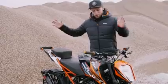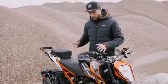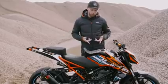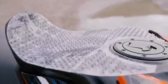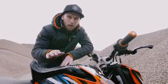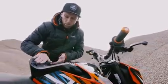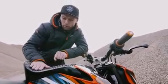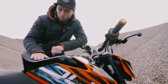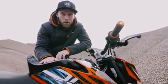So, for this 2018 stunt bike we needed to develop a lot of new parts and update the old ones since this bike has a new frame. Let's start at my favorite part — the stunt tank. Finally, after I got my first Duke back in 2011, this new model has a metal tank, which makes it much easier to reshape. We cut away the top and added a lip, giving a nice shape with a lot of stability when sitting on it. We also added Blackbird rubber grip tape for more grip on wet surfaces. Now I can step up my high chair game.